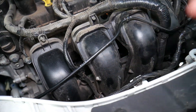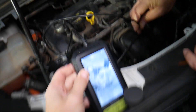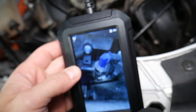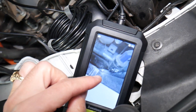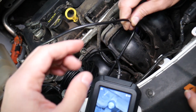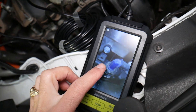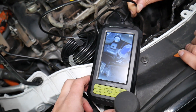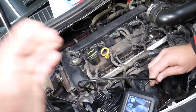Another thing that can cause a vacuum leak is the PCV valve. It's located between cylinders two and three — we'll use the endoscope camera to show you without taking the engine apart. The PCV valve's purpose is to handle blow-by gas; the engine creates pressure that needs to come out, otherwise you'll develop multiple leaks and engine damage. The valve sends oil back to the engine and routes air directly into the intake manifold to burn through. If that valve is stuck open, it causes vacuum leaks. It's a serviceable item most people never replace, and a bad PCV valve can also cause increased oil consumption.